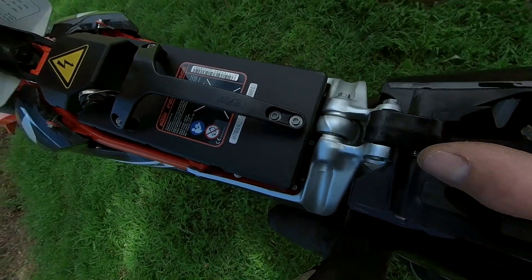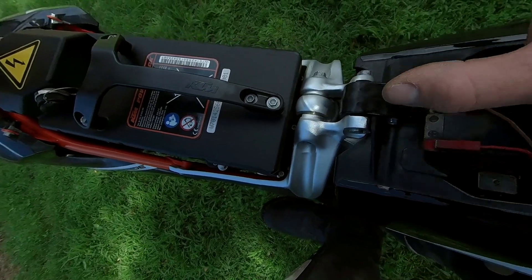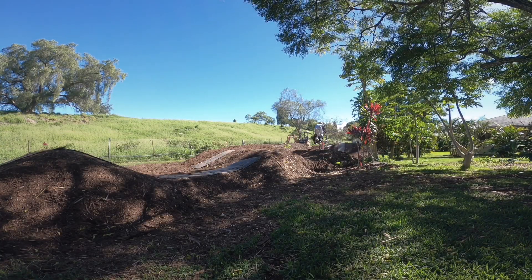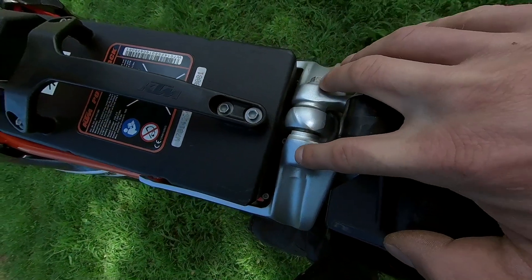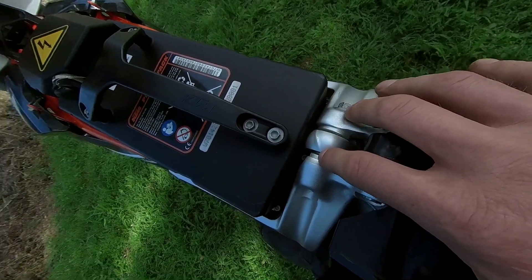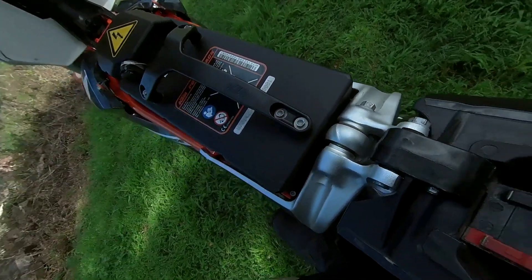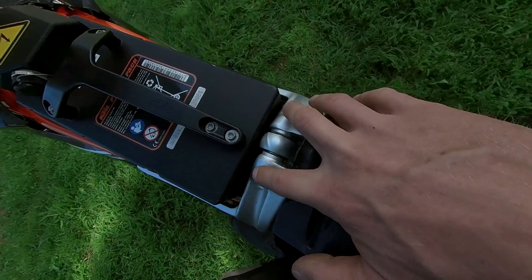Since I've got this popped up, I'll talk about jumping these bikes. They fall like a ton of lead from the air — they're not gas bikes, they fly different, they ride different, it just is what it is. This bike was not designed to hit 58-foot triples like I'm doing on it. This top shock bolt is a weak link — it bends if you land hard from huge hits. It's not a problem; you can actually ride with it bent. I've taken such huge hits that my frame flexed and I have a small dent in my battery from the shock whacking it.